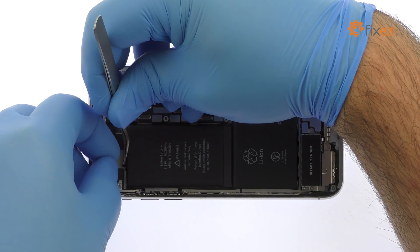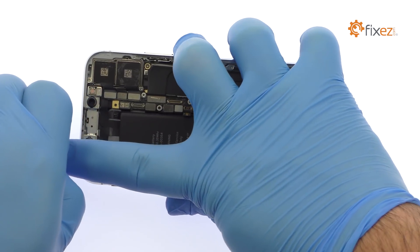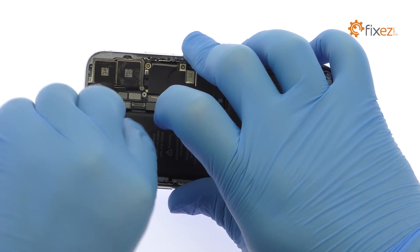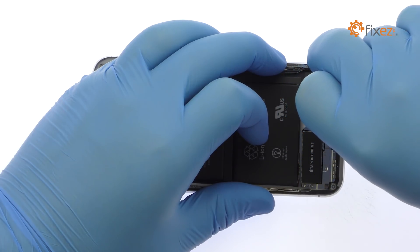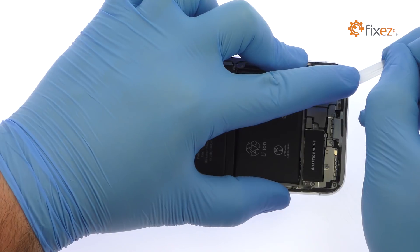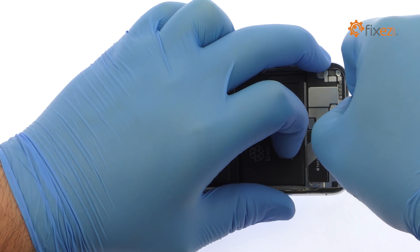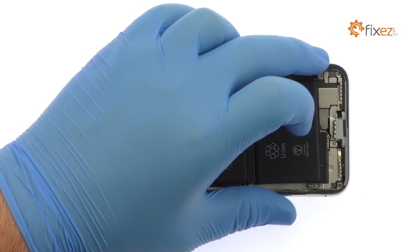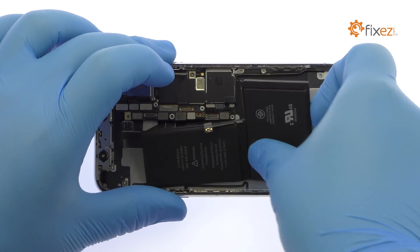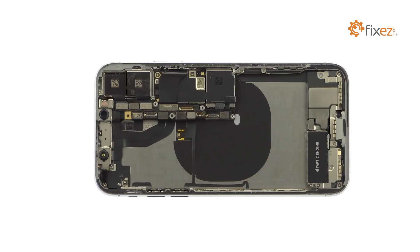The iPhone 10 dual cell battery has four adhesive pull tabs. The pull tabs are adhered to the sides of themselves rather than folded over the top, making this step a little trickier than usual. Slowly and gently pull each strip up and away from the iPhone 10, keep pulling until they come out from between the battery and the rear case. With the adhesive removed, the 2,716 milliamp-hour iPhone 10 battery is easily extracted.